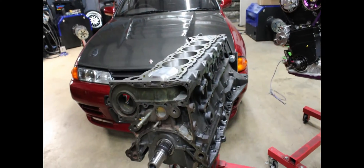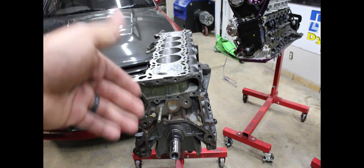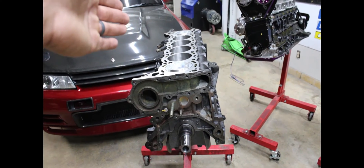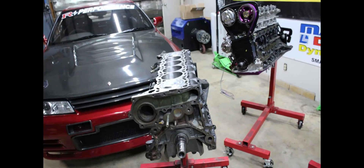The cost of this is very inexpensive. Most machine shops can do it — it takes a day. They just fill it before they do the machine work. If you want to get technical, you can put a torque plate on it, let it wait 24 hours, and then simply do your machining from there.